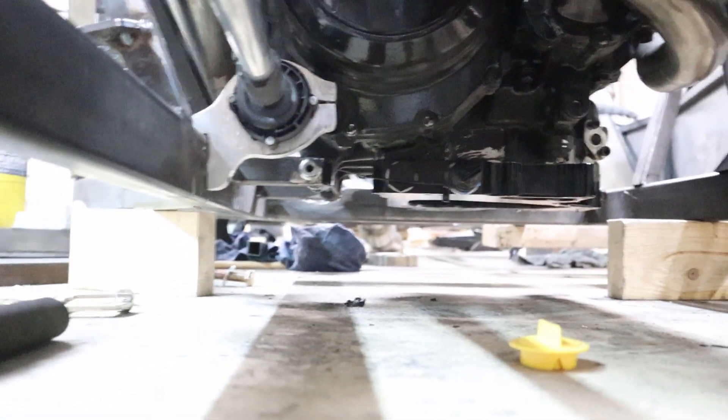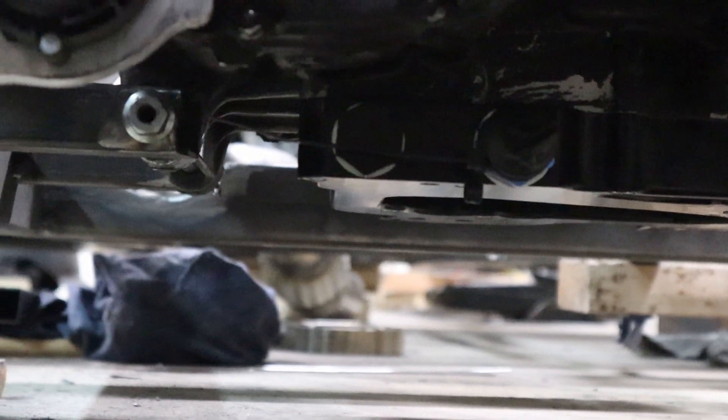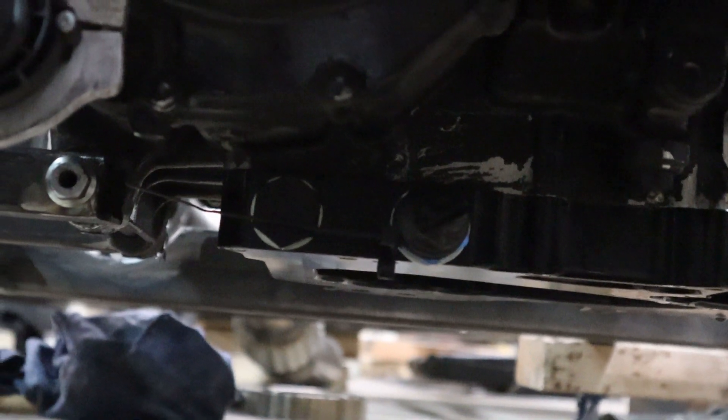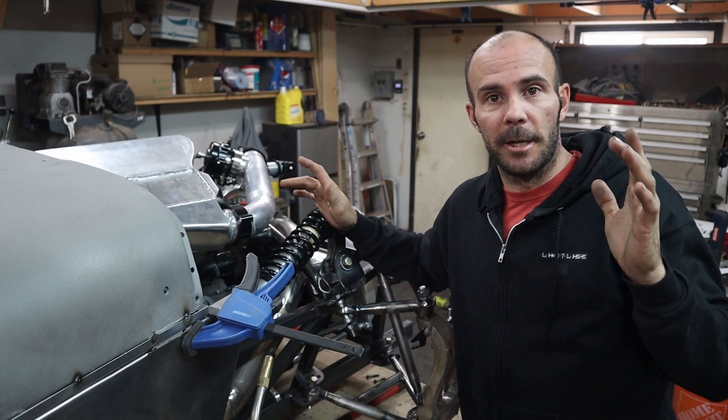Now that the engine is back in, here's another big advantage. You can see the dry sump right here, and the two bars that I cut off are one right there and one just back there, right where that bolt goes through. Cutting those two bars leaves a really nice space for the oil line. I'll be able to run the oil line through there to just behind the engine, which is where the dry sump tank is going to go. This line right here is the suction side — actually, that's the side that primes the engine. That worked out pretty nicely. I could possibly go underneath of it, but it might be a pretty tight squeeze. So the engine is back in and I'm going to wrap up the episode there.